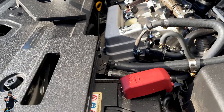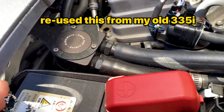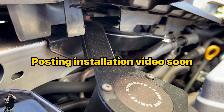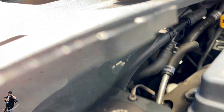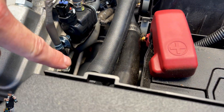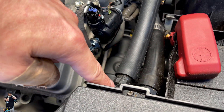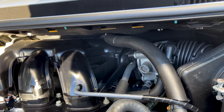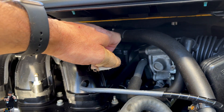If you have a look in here, it's a nicely installed Mishimoto catch can, just mounted up there. You can see the screw there, and then your two pipes connect to the catch can. Your outlet from your rocker cover goes into the catch can here, gets filtered, and your clean air goes up into your intake manifold. Normally your dirty, oil-filled air would go straight to your inlet manifold.